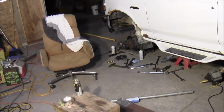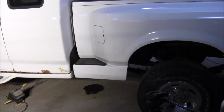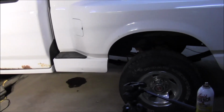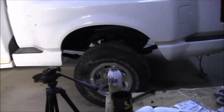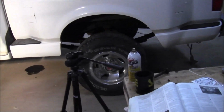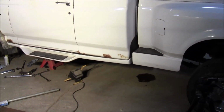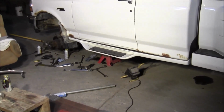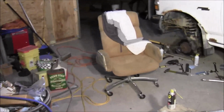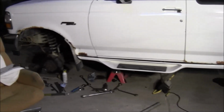really it should be about ready to go for the winter, I think, except I'd kind of like to get the front fuel pump replaced as little as I want to do that. It would make me feel better because I don't know how old the rear pump is. I don't think the rear one was original. When I replaced that rear tank last weekend, I didn't see a Ford marking on it anywhere, so I don't think that's original. With 140,000 miles on the truck, or 140 or 160, I don't remember, it could go a long time, or it could die tomorrow. The ones in my other truck, the front one was still working at 261,000, but aftermarket tends to not be so good.